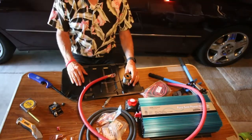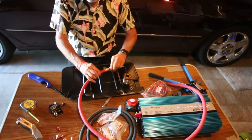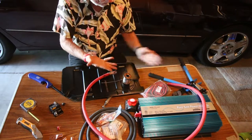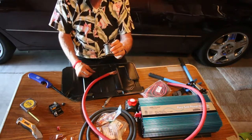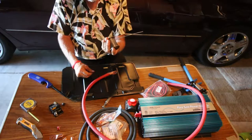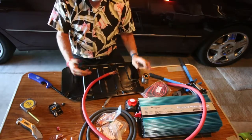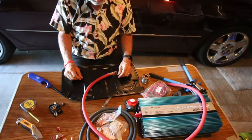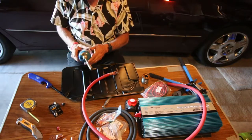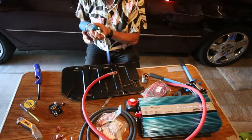Okay, we've done some crimping. I put it down on the cement and put my foot on top of it. It seems like it's holding pretty good, but it's a little oblong on one side — I didn't get that good hex shape since I can't use the proper tool. So I've got some solder — this is 60/40 with number 44 resin core, 0.093 inch diameter. We're going to use a propane burner and let's see what we've got coming up. Safety glasses are checked.